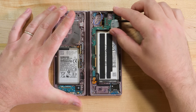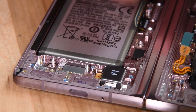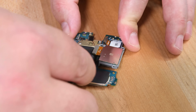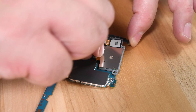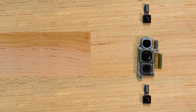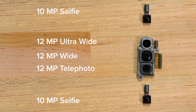There's a second board in the other half of the phone and a third one for the USB-C port and the vibration motor. The original Fold was famously stuffed to the gills with cameras, so much so that the folding screen had a huge notch to accommodate some of them. The Fold 2 shows a little more restraint with only 5 cameras: 3 rear-facing 12-megapixel cameras — ultra-wide, standard-wide, and telephoto — and two 10-megapixel hole-punch selfie cams, one for each screen.